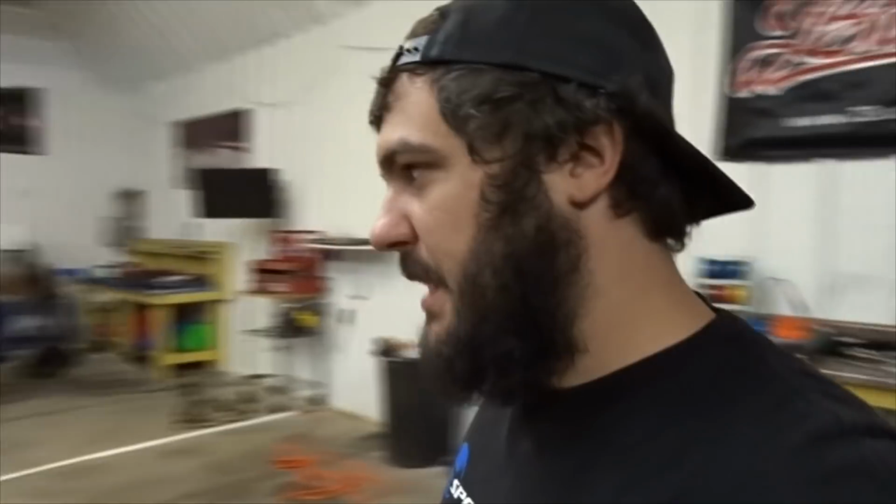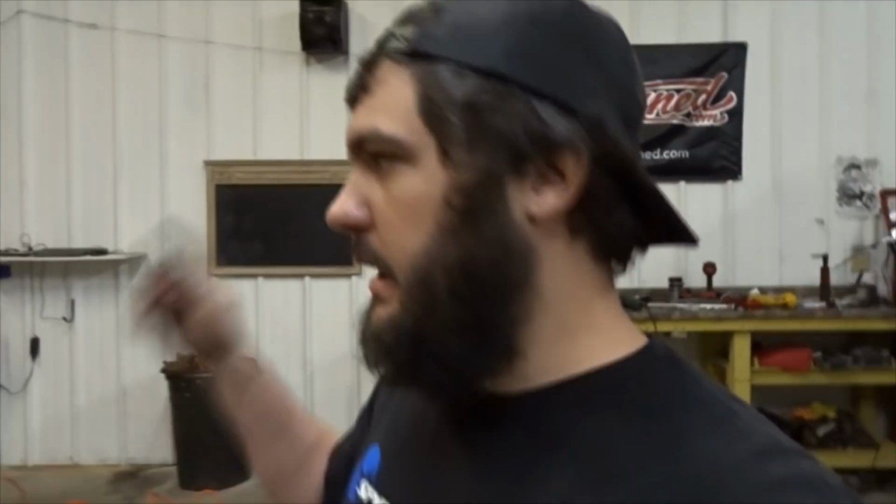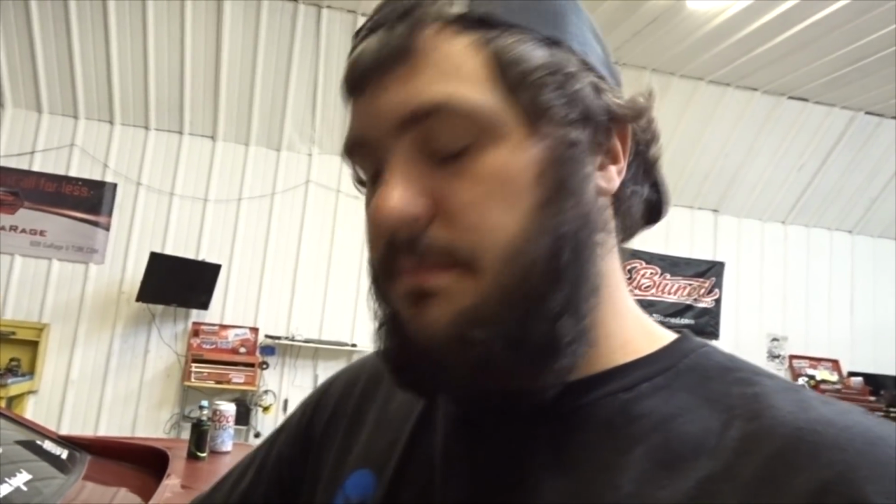It's been a long day. We've been on the dyno literally all day with the Mustang. I got maybe a couple clips on my cell phone and maybe only one clip on the camera here. The car has been doing good, but it's just not making good horsepower. And I don't know if it's an issue with the dyno or if it's an issue with the car. I didn't change anything on the car. I pulled the motor and trans out and I redid the whole rear suspension, whole front suspension.